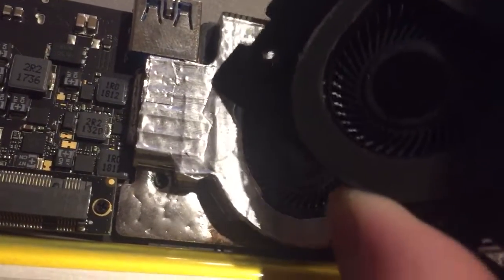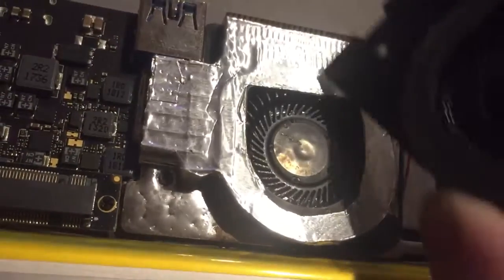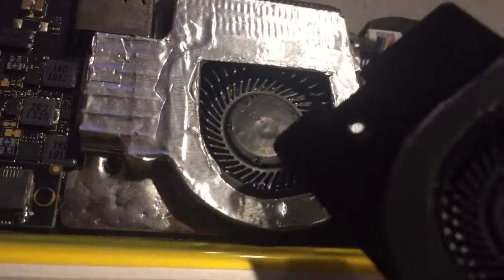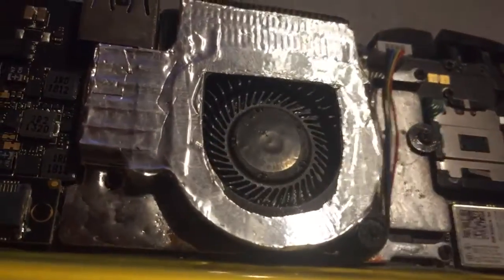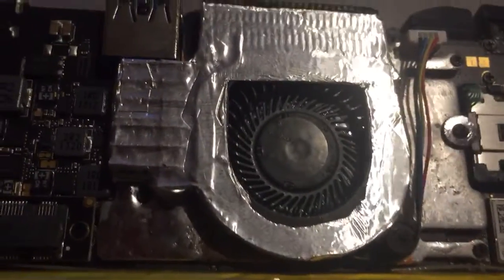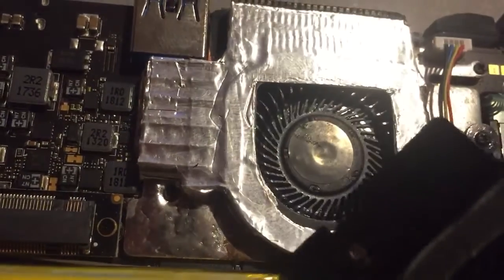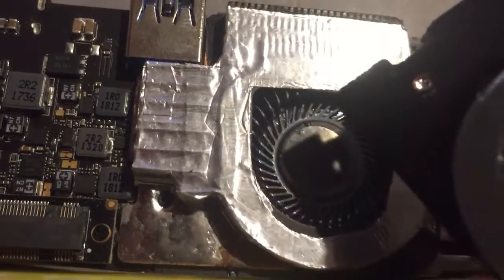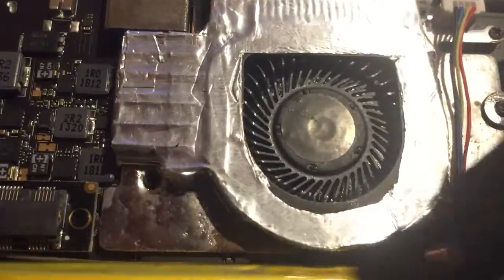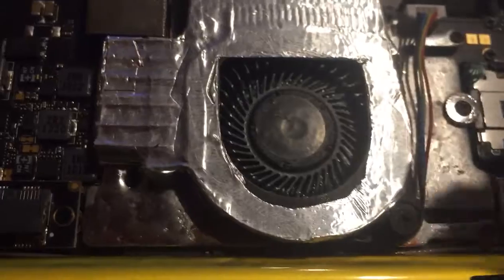There's a big air gap over here, and then I had to cut the side of the fan plastic out. So the air flows in from below and out this way. Most high-end gaming computers or performance workstations use the same technology - they blow air from multiple directions. So I figured, if they do it, so should I. So I soldered these aluminum heatsinks in there like that. And holy balls, aluminum is very difficult to solder to - what a pain. Then I installed those two, cut the plastic out around the housing, and put this foil tape all the way around. Trust me, there's no air coming out of this thing anywhere.